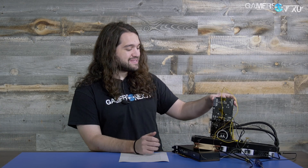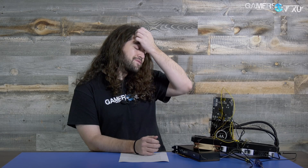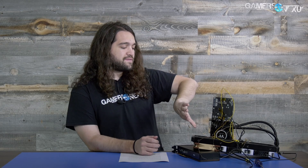This is not really a direct comparison anymore because we've also installed power play tables — a registry hack that Buildzoid provided with help from Helm from the overclocking forums. That allows us to do up to a 242 offset, which is enough to kill the card if it actually pulls that much. It's kind of hard to get it to pull more than 31 amps, but we did hit 33, which is pretty high.